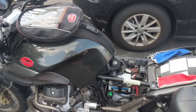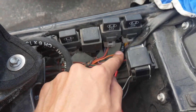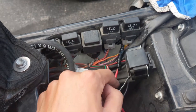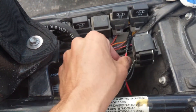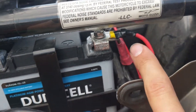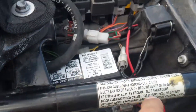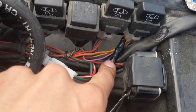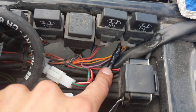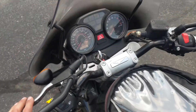Okay, so here's my final product. Just to recap: I've cut my red wire on the starter relay, which is on the far right on the 750 Brevas. I tapped in my own wire and put it straight to the positive terminal of the battery. I did a crimp connection here and a little extra electrical tape, and here I did soldering and a lot of electrical tape and shrink wrap. That should be all you need to do to get rid of your click problem.